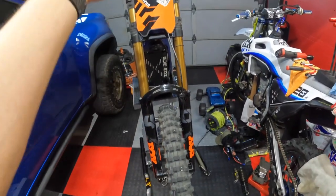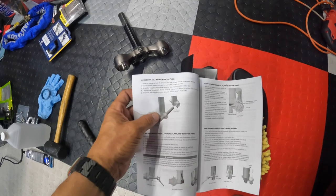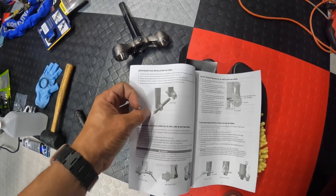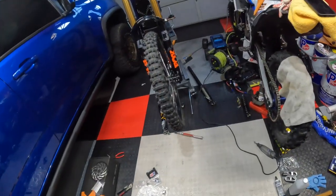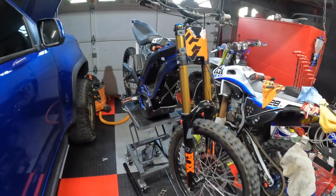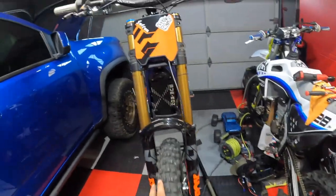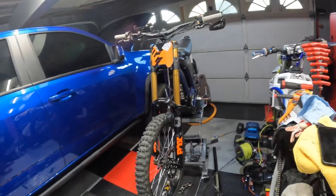Not entirely too worried about it. Last thing I need to do is tighten up the pinch bolts, throw some air in here and set it to the recommended Fox pressure. For the pinch bolts, it looks like we're going to do 19 inch pounds — all the way down, even the axle bolt too. So 19 inch pounds all the way around, and that will pretty much wrap up this little video. Hope you guys enjoyed it and hope it makes installing yours a little easier on the 2022, or 2021 and up — not really sure when they changed to the tapered bearings. Hope it helps — see you guys in the next video.